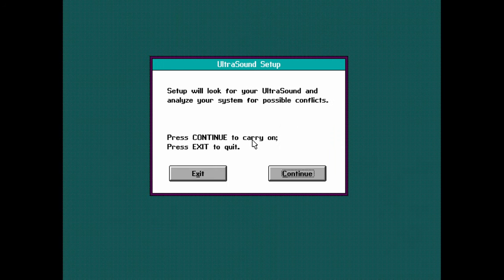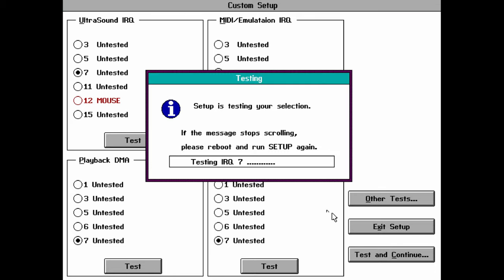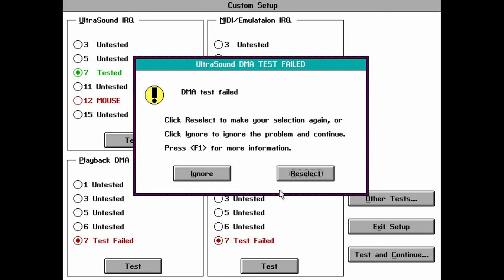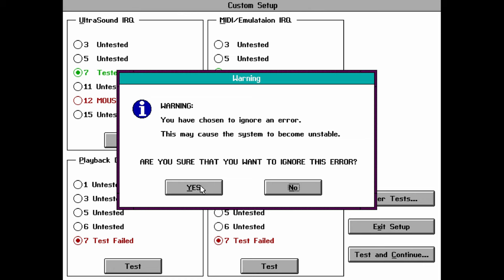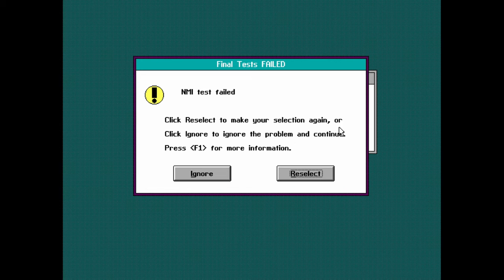Original Gravis cards use a series of patch files with recorded instruments to play MIDI music. And since this card uses the same system, it also works the same. The system Gravis developed is quite smart and easy to use. The card loads instruments into its memory, and since each instrument is one file, the card doesn't need to load all the instruments at once, as you may be familiar with in the case of the SF2 format. It just loads the ones it currently needs.